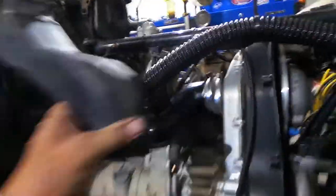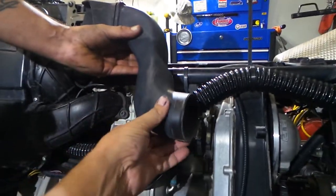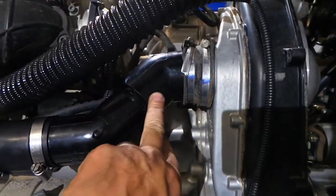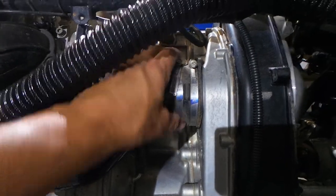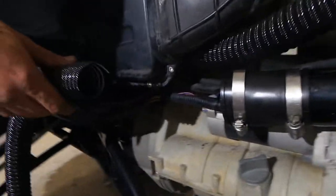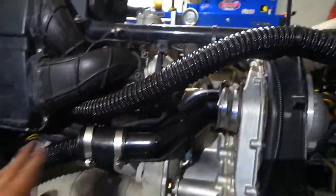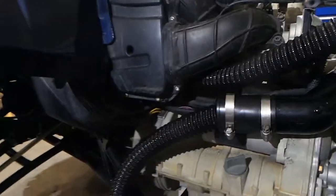This is your CVT intake, which went kind of like that. All that comes out and you don't use that piece anymore. This is the PVC pipe going into that connection — it seems way smaller, but it does clamp down and gets a good bite. Just like back on the CVT, this is sealed, but we'll still run a bead of RTV and seal it one more time for insurance. Then this hose plugs into that adapter and runs up the rest of the way. So we have our exhaust pretty much routed in here and the intake on its way up.